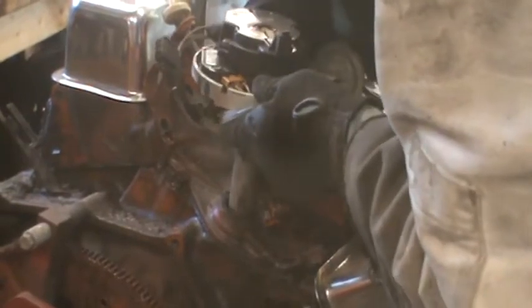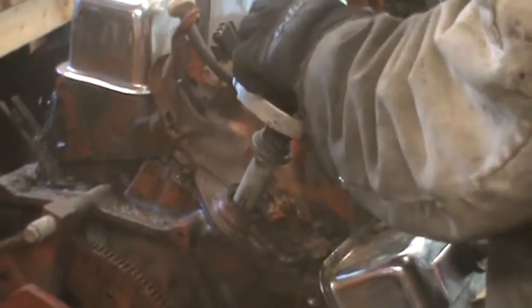It's a little harder to do with the engine tilted — you've got to get the distributor perpendicular to the engine, not following the tilt. It's hitting on the gear, and it needs to drop just a little bit more. I have it off a tooth — this is a lot easier when the engine is in the car normally.